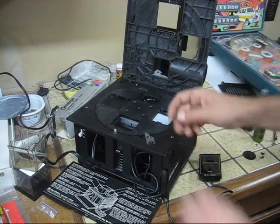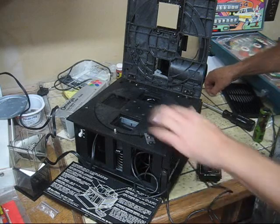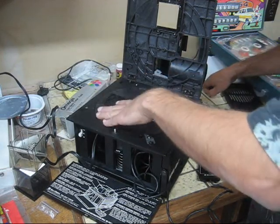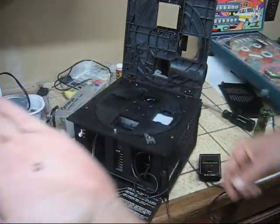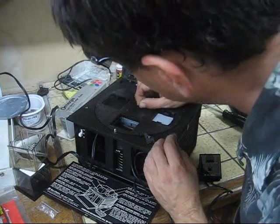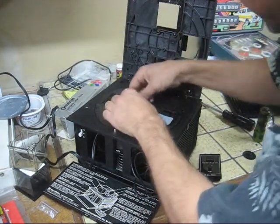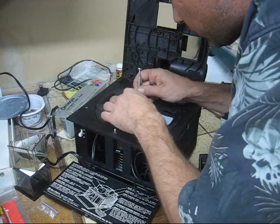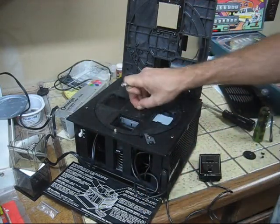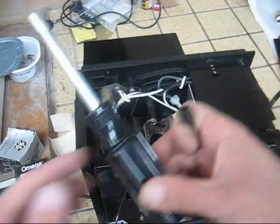You can see that it's rotating very well. Same thing over here for the center - make sure that's lined up with the teeth and setting down straight. Take the smaller of the two spring clips and put that back in right there. You can do this with your fingers or a screwdriver - just be careful your spring clips don't spring.